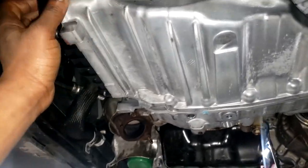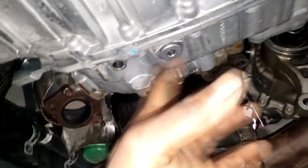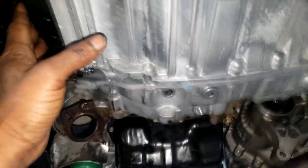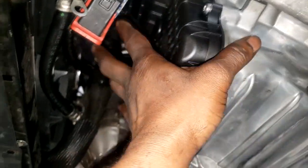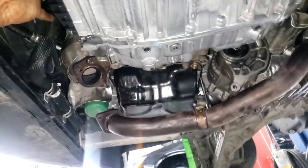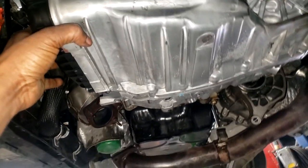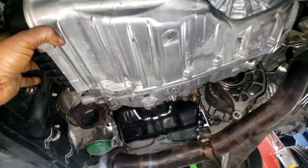Remember I told y'all about the 948TE drain plug — right here, and the fill plug is up top. Drain and refill is about all you can do on these. You can't do a transmission pan service because there's no accessible filter — the filter is up top and you've got to remove the transmission in order to replace it. That's right, to replace the transmission filter you have to remove the transmission. Check out that video where I talk about that. For now let me finish getting this transmission back in — thanks for watching.